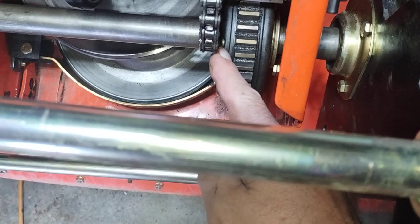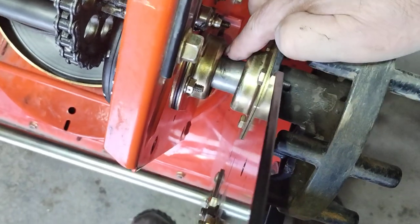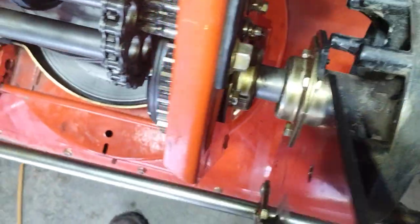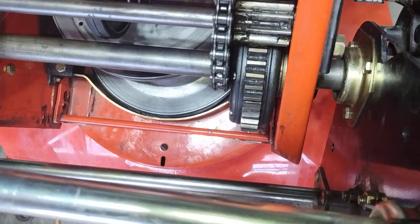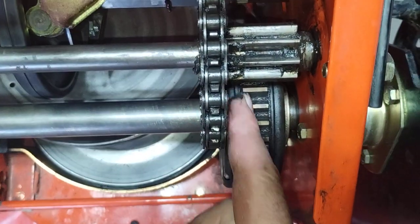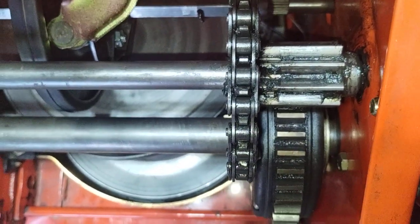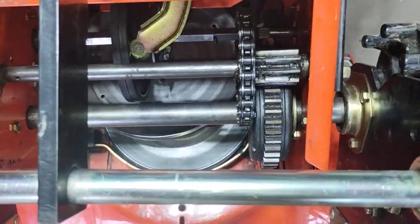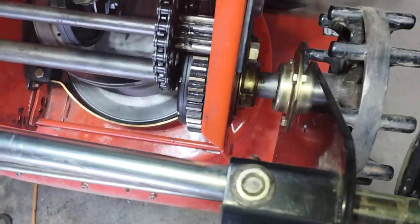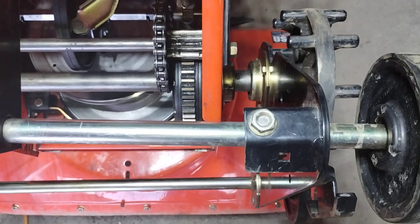I'd want to avoid that — the edge of the differential to the edge of this chain. If I were to just put a washer in here, it wouldn't need to be much. An eighth of an inch here would add that eighth of an inch there. Aaron said play is normal, and as you can see by the grease wear marks, that's grease wear, not actual gear wear — that's where it's been all along. So do I go ahead and put another shim in here to add space? Hopefully that makes sense. This is quite literally my very first video — I'm a regular Francis Ford Coppola.